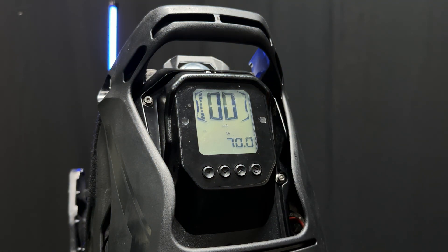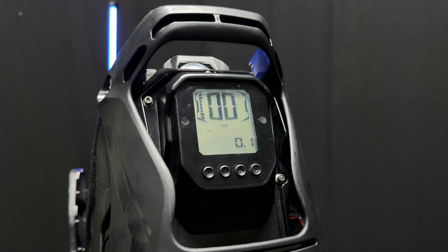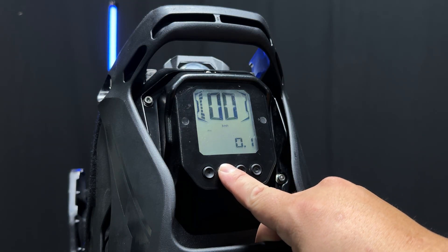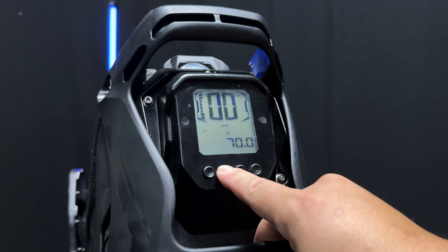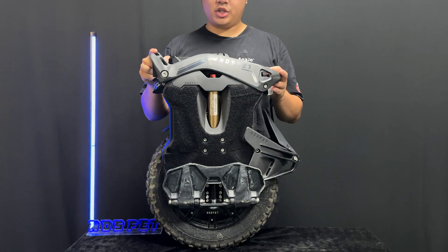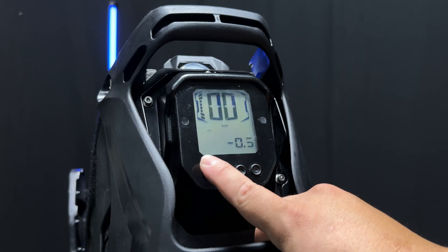We're back at MD, which is ride mode. The next one is ANG, which is vertical angle adjustment. This stands for the angle of adjustment forward or back. You can tilt the wheel forward or back beyond the gyroscope calibration. You should always calibrate your gyro completely level, but if you do want your pedals to tilt back or tilt forward, you can adjust this number. If you increase this number it'll tilt forward, versus if you go into minus, it'll tilt it back.